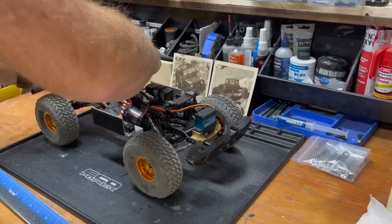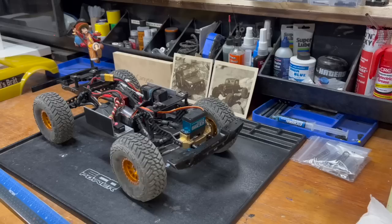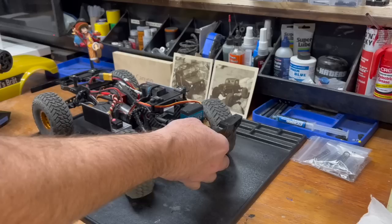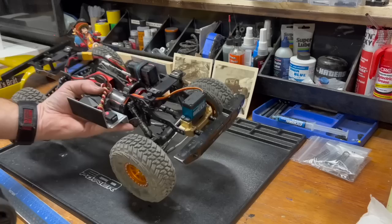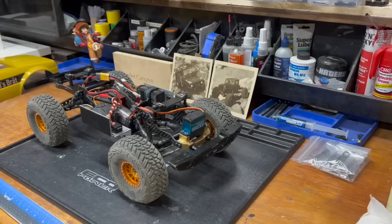Radio. Hey, over five volts — that's all we need. Oh, I see what's happening now. There's some issues with the amount of droop in the front. Yeah, the front is now drooping farther than I would like. You see the corner jacking up? What's happening is — and this has nothing to do with the shocks — the steer link is clearing the front link right there. If this has any load on it, it hits it.